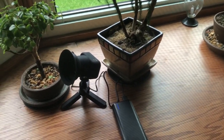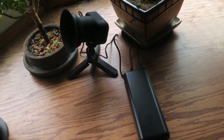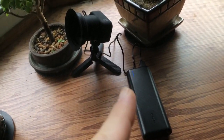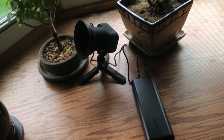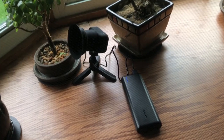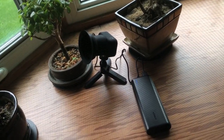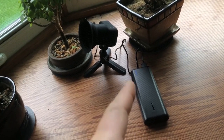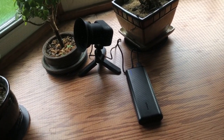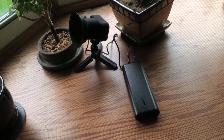It's been 24 hours now and turning power saving mode off on the camera has worked — the battery bank is still on. All four blue indicator lights are still on, so it is drawing very little power, which is a good thing. I just wish you could use a battery bank with power saving mode on, but most battery banks do the same thing — they'll all shut themselves off if there's not enough current draw coming out of them.